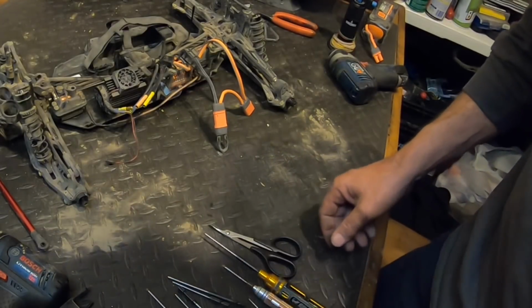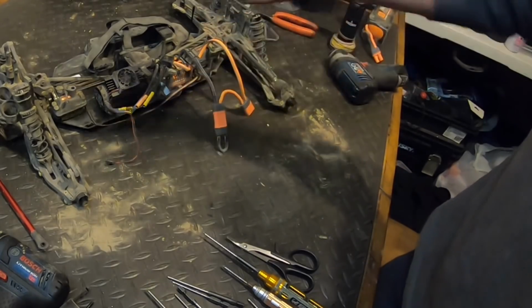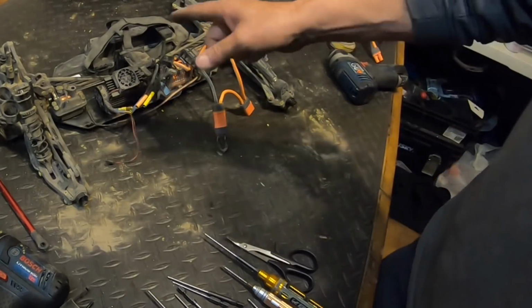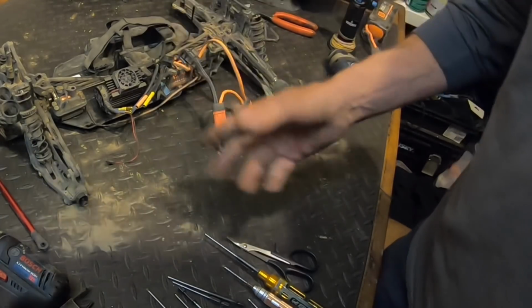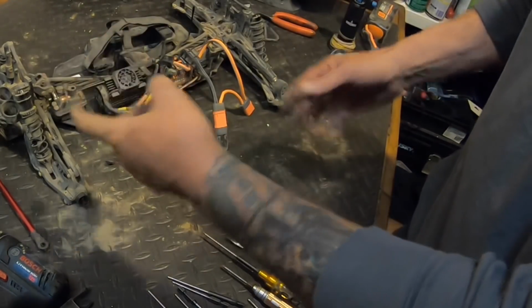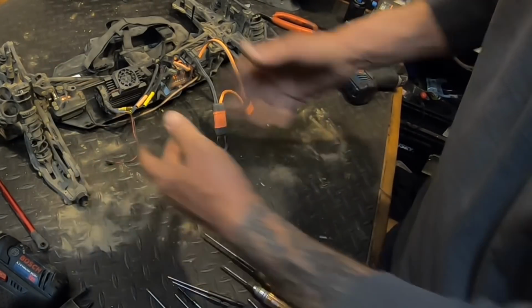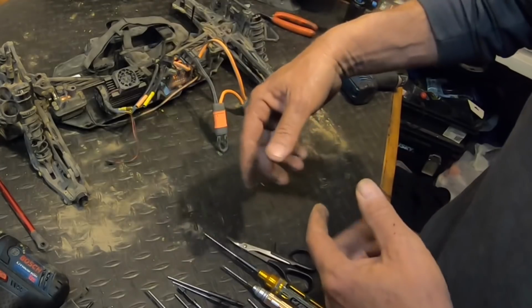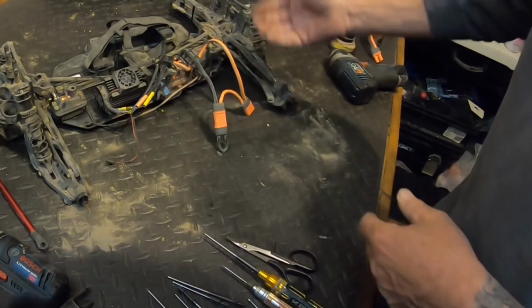But that's going to end this video. Footage is too long. We're going to continue on. Stay tuned for the next video. We got the high-speed gearing in there. We stiffened up the center diff. I'm going to put it up. I'm going to test the handbrake and see if it stops all four wheels or if it still just stops the rear. That's why I didn't drain the fluid out. I just added to it, trying to stiffen it up a little bit more to try to give me some front wheel speed.